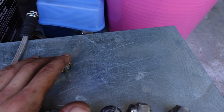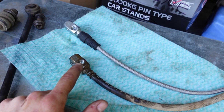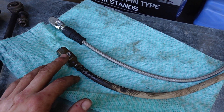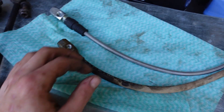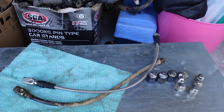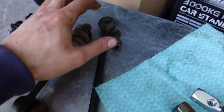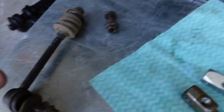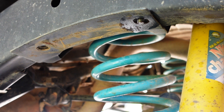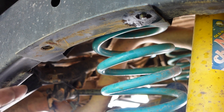Managed to get the rear brake line off - the flare nut that goes up here is stuffed, one of the other flare nuts is also stuffed. The other side I managed to get out even though I was using a brake line spanner. That's the new brake line there and it is heaps longer as you can see. The sway bar bolt snapped or was seized so I cut it off with the grinder. Then I went to undo the bump stops and the bolt snapped off in there - I WD-40'd everything beforehand but we've got our little friend here and I reckon that should help us get it out.